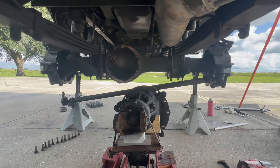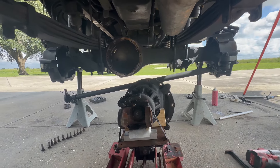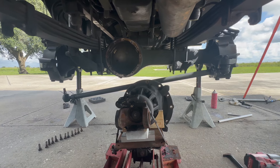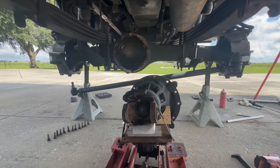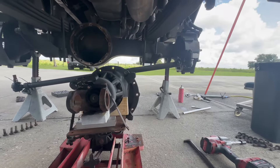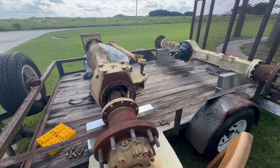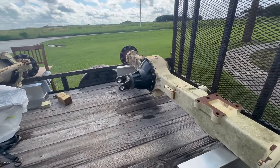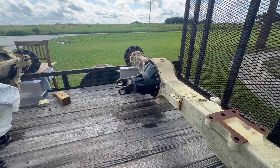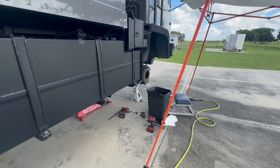Working on pulling the center section out. While I'm doing the seals, I'm also changing the gears — years ago I put the 3.07 gears in, but now that I'm going to eco hubs I decided to go back to the 3.90 gears. So I get to change out the center differential again. Luckily I still had the old axles available to me — these are off of an MRAP. I pulled those back out and swapped the gears back around. Big heavy job.